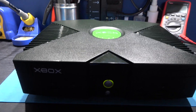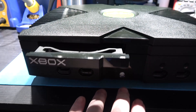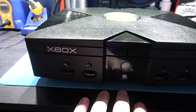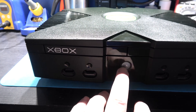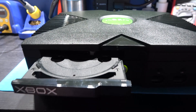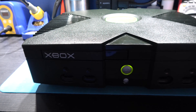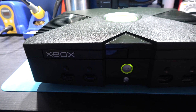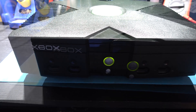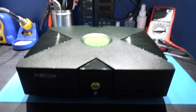The Xbox is all back together, so let's give it a test. I'm going to press the eject button — and as you can see, it's ejecting perfectly fine now. First time, every time. This is a very common fault on the original Xbox and it also affects the Xbox 360 as well. All you need to do is replace that drive belt. I hope you enjoyed this video — it's a very simple fix.